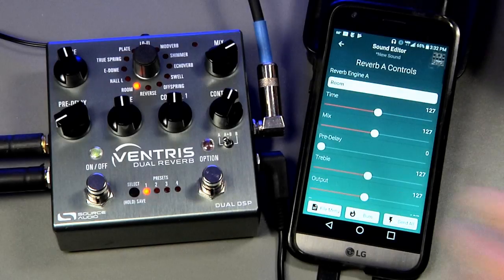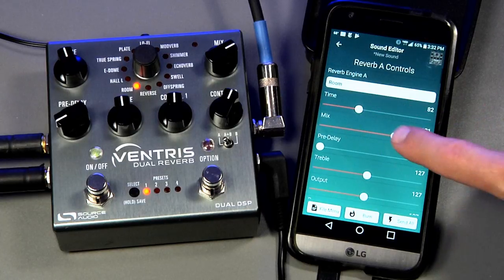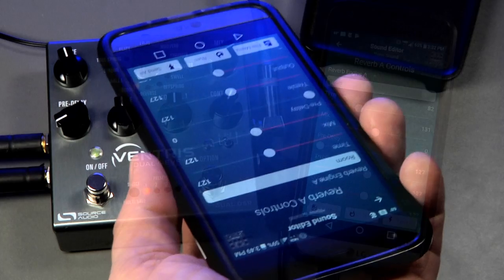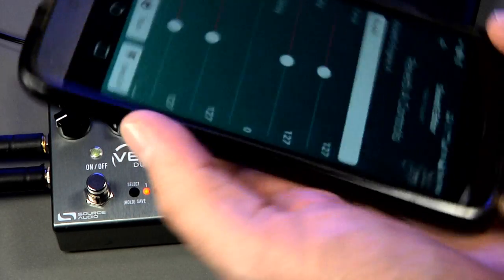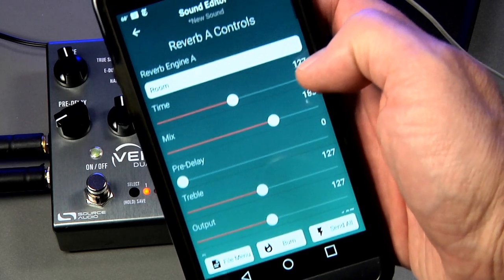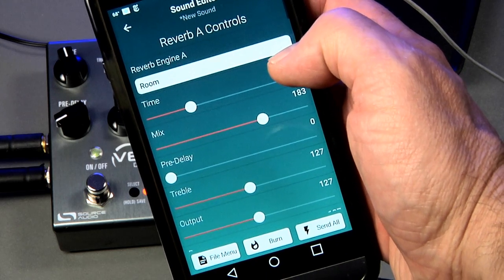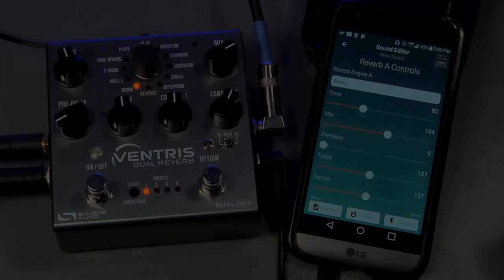Number four: test the phone's output. If you're still having problems, try unplugging the Neuro cable from the phone and moving something in the sound editor. If you hear a burst of noise after moving a slider, you know that the app is working. You should also try plugging headphones into the jack to make sure the output itself is sending signal — don't put the headphones directly on your ears as it can be quite loud. Move a slider and make sure you hear a sound coming from the right channel of the headphones.